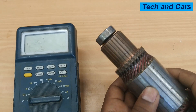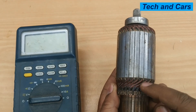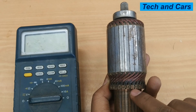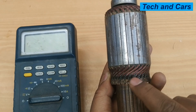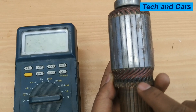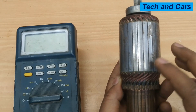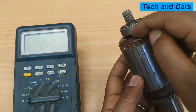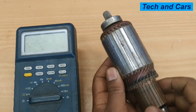There are different tests that you can perform using a multimeter on a starter motor armature. Basically, we are going to inspect the well-being of the coil. As you can see, here is the commutator segment — there are electrical windings that originate from the commutator segments, travel through the winding, and are all interconnected. It seems there is only one wire coming from each commutator, but internally there is another round of coil. One line goes this way and there is another line below that travels in the other direction. All these wires are interconnected — a line that goes here comes back somewhere and connects to another commutator segment.